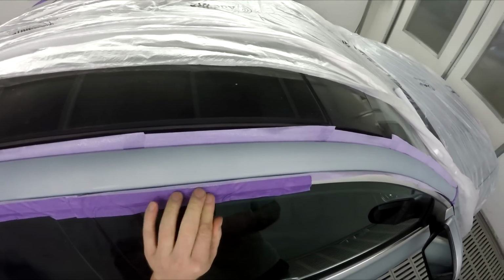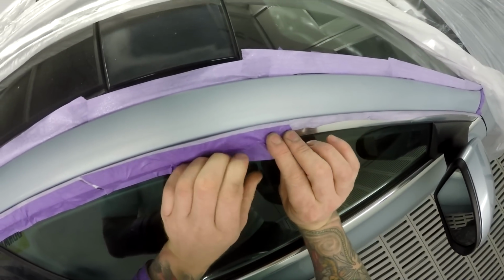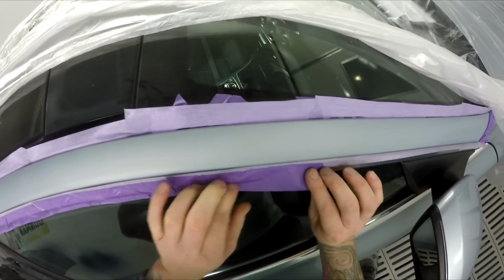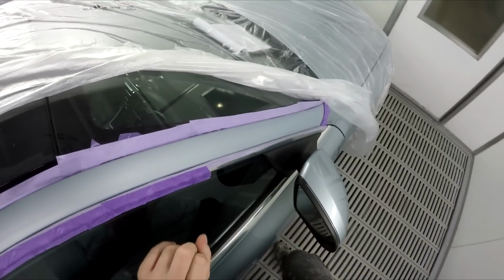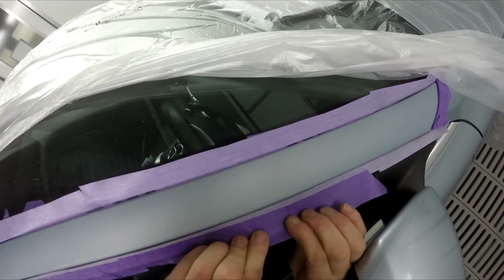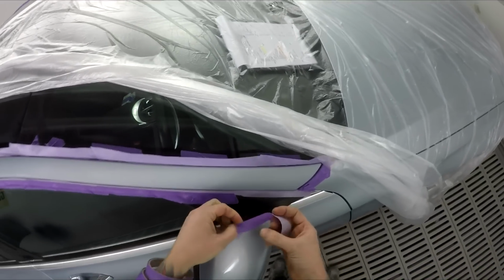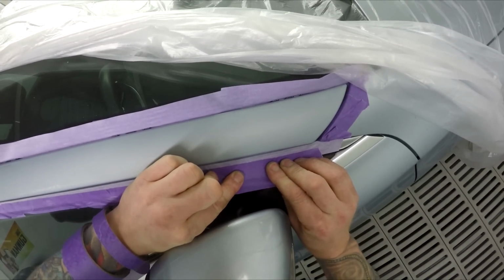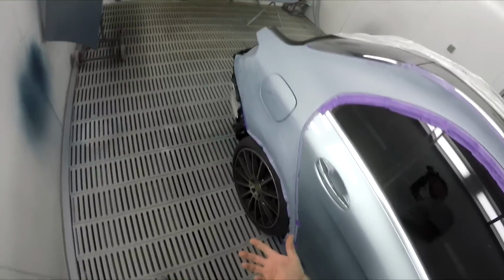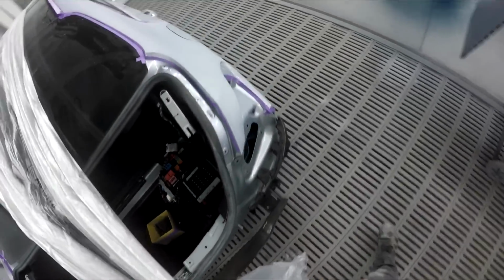I thought it was to do with air being less or more dense during the colder or warmer weather, but it's not. It's literally just to do with the thickness of the paint. In winter, the paint's going to be a little bit thicker, so you're going to need more pressure to draw the same amount of paint out. Nick Joyner did tell me that, and I thought, okay, he could be right. Then I put it to the test, so I actually know from practice that he is right, not just taking someone's word for it. I heated the clear up one morning, and it turned out that even though the weather was colder, I actually needed the lower pressure. In the afternoon I didn't heat the clear up, and it turned out I did need the higher pressure.